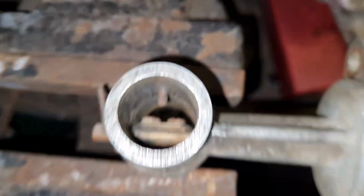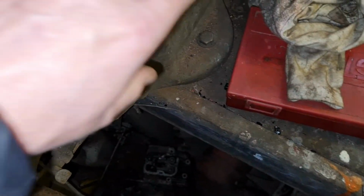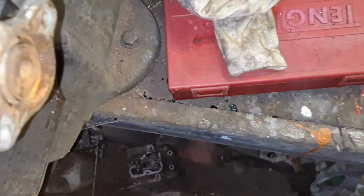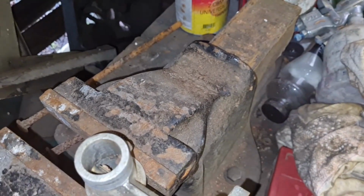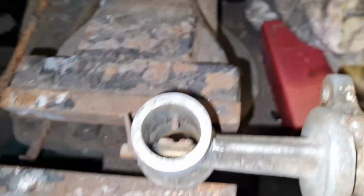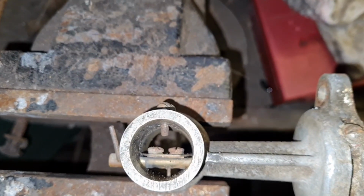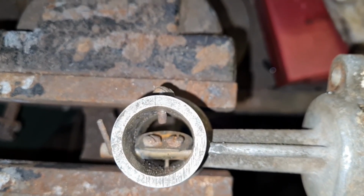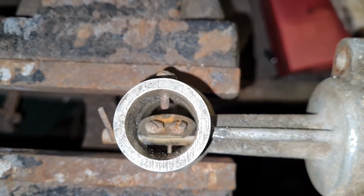The choke is now fully open, of course. Well, that's not even hot to the touch, it's just getting warm. Let's put my heat gun on the cold setting. Come on, blow cold. That's blowing coldish. And that should close again now that it cools down. There we go, look at that.